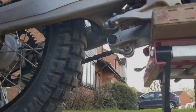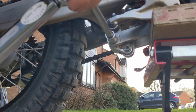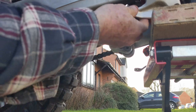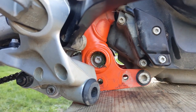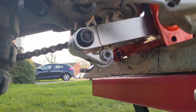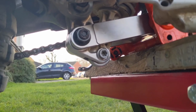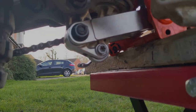I've just nipped up this bolt here. I'm going to check the torque value, which is meant to be 60 Nm. The two other smaller ones I did at 20 Nm. I think we're good to go — all complete, it's in there. Nice, done. Not too bad a job, wasn't too difficult. So we've just got the forks to do and to put everything back together.